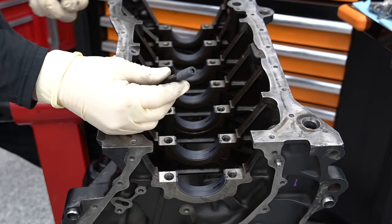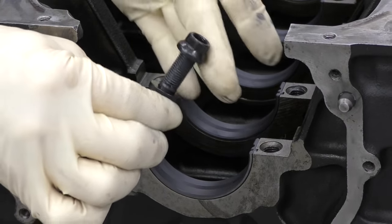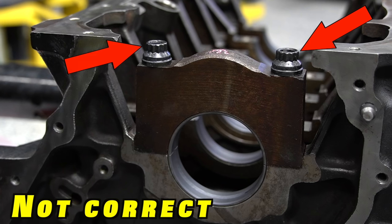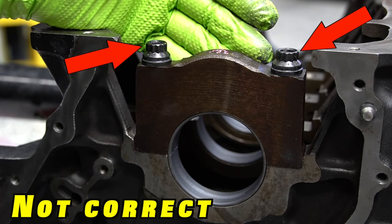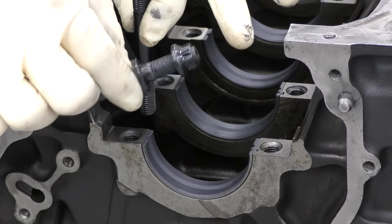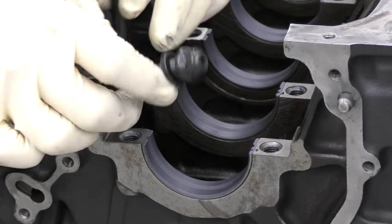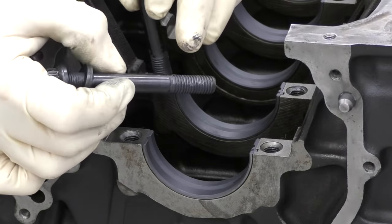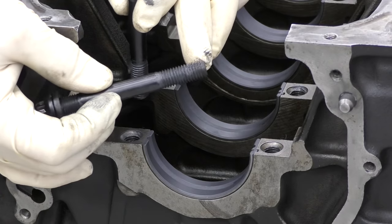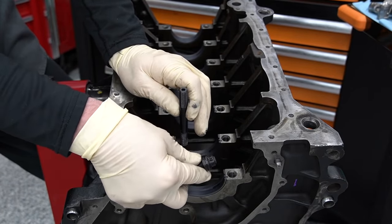We have our stud — drop our washer on, then thread the nut on just to the point where we have some threads poking through. If you just thread the stud into the hole hand tight like the instructions say, you won't have enough threads biting the nut. In conversations with ARP, they told me to not run the washer, which I don't love. So we're going to install them this way and torque it down properly. I did some base-level measuring and doing it this way you get about 1.5mm more thread bite than with the factory hardware — this is common VR6 practice and should work absolutely fine.